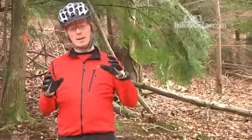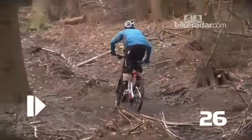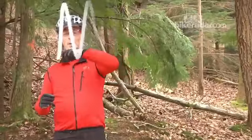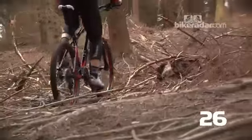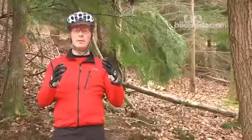For me one of the biggest advantages of 29 inch wheel bikes is climbing. What helps the climbing is the way that the torque the rider generates is used at the contact patch. On 26 it's quite spiky — you're punching the power down. If you imagine the torque on a graph, it would look like some sort of weird heart ECG: big torquey spikes, a very short amount of time at maximum power — that's where your tread is going to slip. Whereas with a 29, the torque application is far different: slightly less spiky, slightly more rounded, a more usable level of torque.